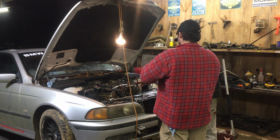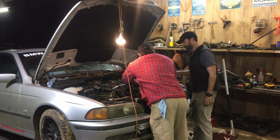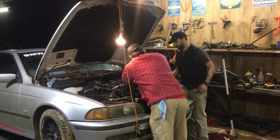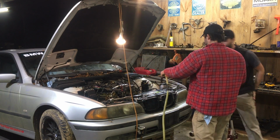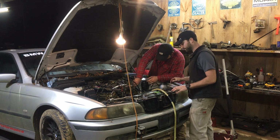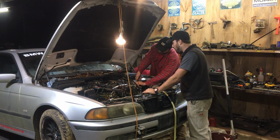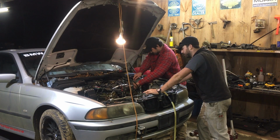A good amount. See, this is very highly technical here. Yep. That's not bad. That helped pretty good. It was blowing out of the ring, I think. Yeah, it was going into the crankcase. We're looking for a little bit of bleed off. You're going to have that. Yep. But most of that was past the rings, so we know the valves are good to go.